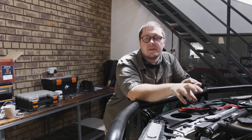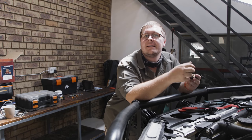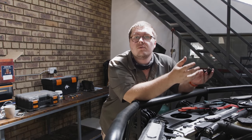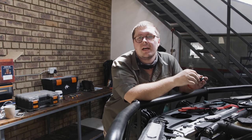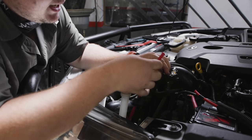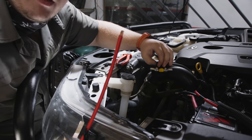The way we've run this cabling for the air compressor is exactly the same way you would run it for a dual battery system — we've taken all the same precautions, using the same lugs, the same type of cable, the same plugs. You could take what we've done here and use it to run a dual battery or something similar. What's nice is we now have another straight battery output into the back of the canopy for anything else that might need a direct battery connection, without interfering with our dual battery system. We need to put a lug on this cable, a lug on that cable, with the fuse sitting in between them, then a lug on the end connecting to the battery.